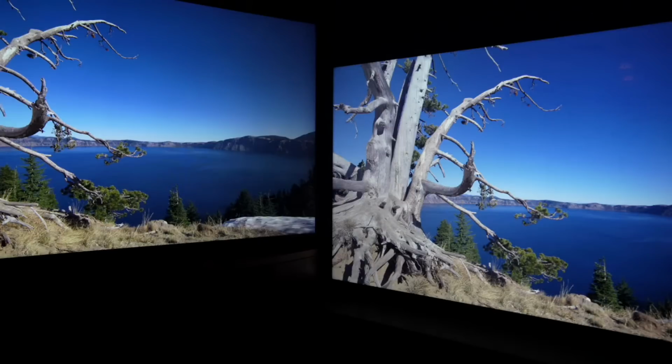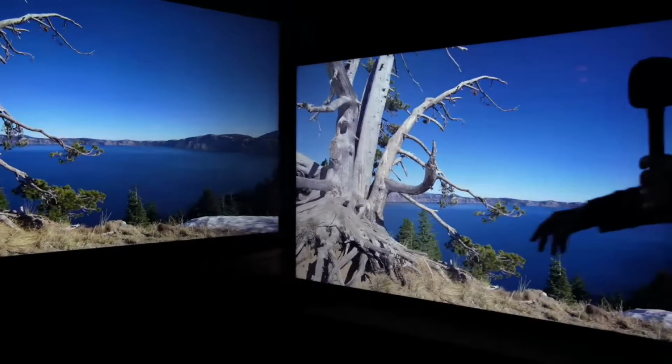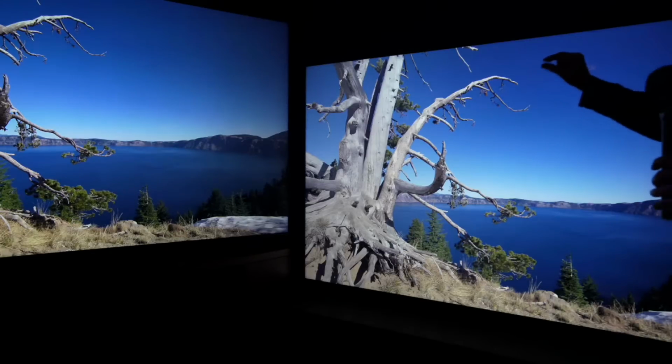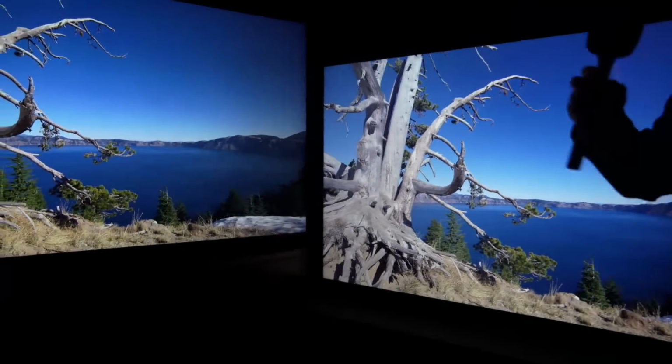They care about only the picture quality, period. They don't care about specmanship. Because when you have a screen this size, you're not going to use 10% at high peak lumens. You're going to use maybe 1 or 2% of the screen area, and that's the way HDR is created. Only specular highlights are a very small percent. So they hold back. They don't put their peak lumens at 10%. They do their peak lumens as needed.